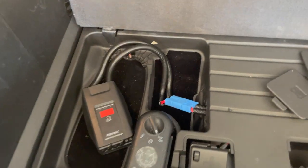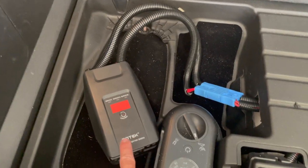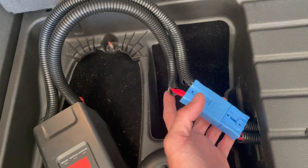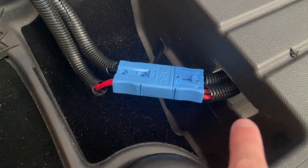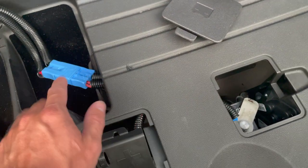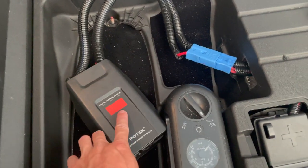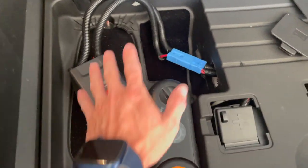In the back of the Volt here, you can see I have a 12-volt inverter rated at 500 watts continuous. I probably won't ever pull that much power, but it can apparently do that. I have a connector here connecting the inverter to the car's 12-volt battery — the negative terminal and the positive terminal. I had to cut a little hole for the connector to slip through, so that it sits flush in the back of the car with the connector coming out of this slot here.